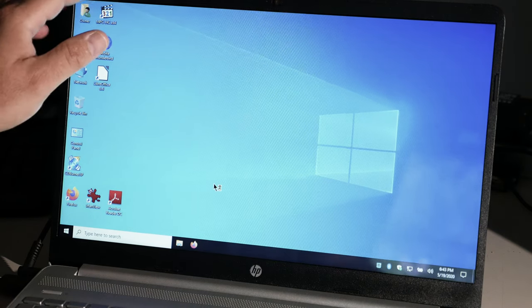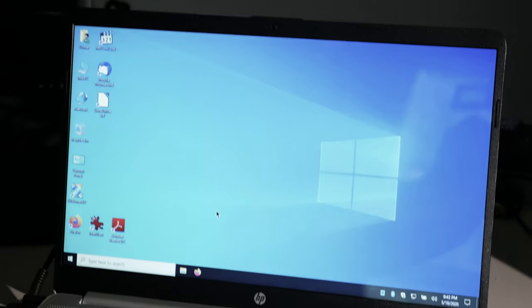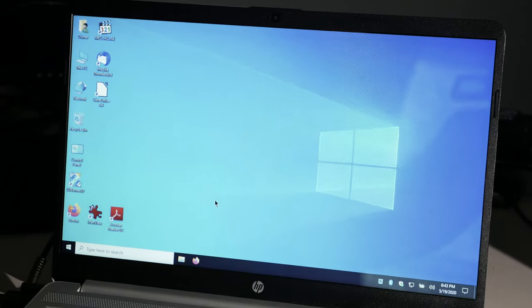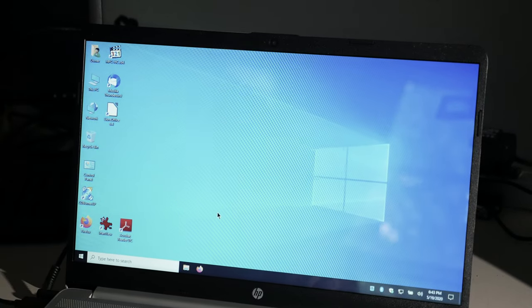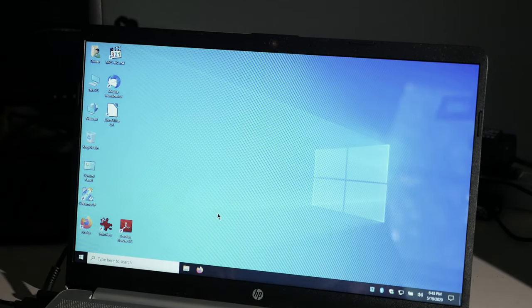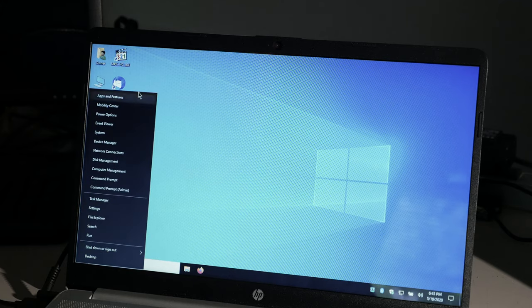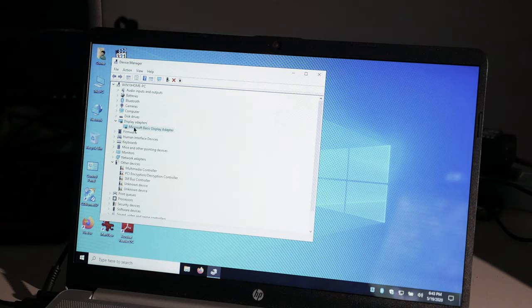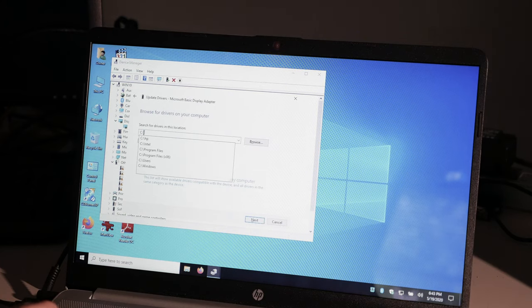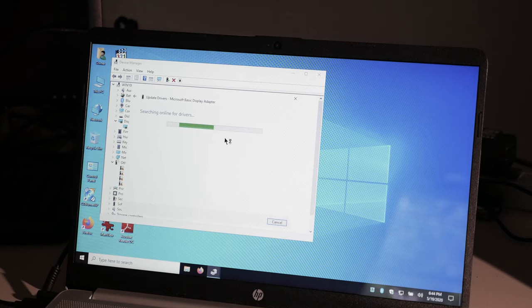This doesn't have a Firefox icon, but check that out. Look at that nice dim screen. Isn't that something? Here, you need to be elevated, don't you? So, look at that. Nice dark screen. It's really dark and hard to read. So, enjoy that. This is the reason that I copy those drivers, because I can't see anything. And it's because it needs the display adapter driver. And often, the display... Oh, really? You didn't ship one with it? You suck. All right, come on Windows 10, I really need this display adapter driver so that the brightness will come back up.